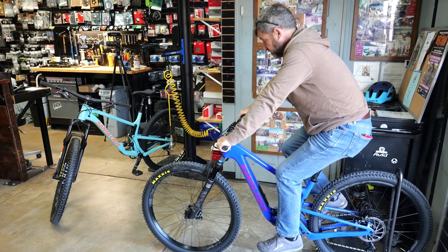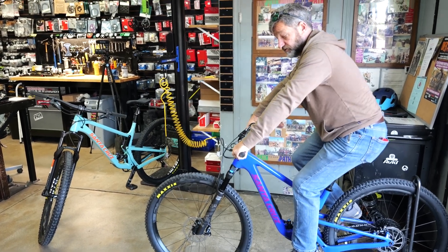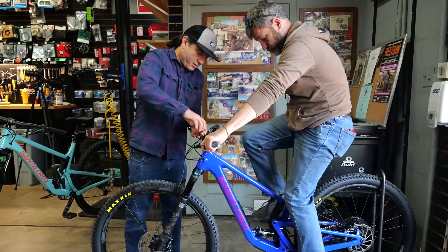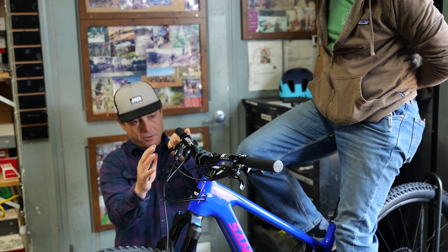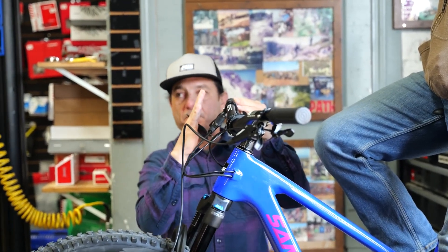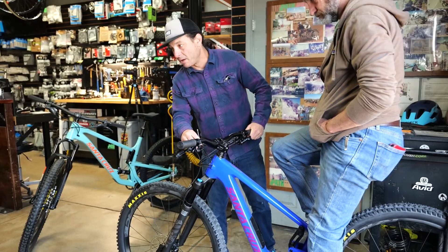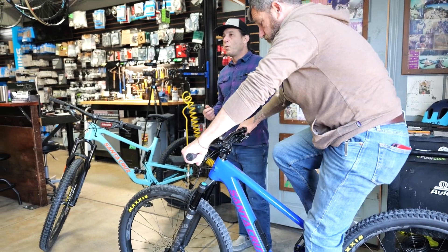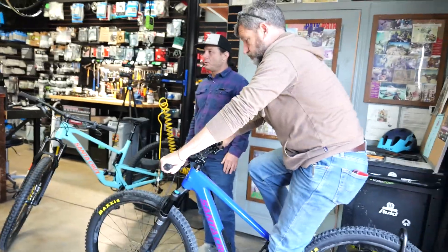One thing I can note is my wrists have a bent-back angle, so the bars definitely need to be rolled forward — I want to be in more of a neutral position. Neutral to me means the grip rises almost straight up, maybe slightly back. Neutral can mean the average of all riders, but it can also mean what puts that particular rider in a position where more would be bad and less would be bad — kind of the Goldilocks spot.